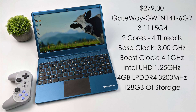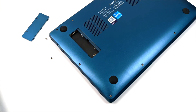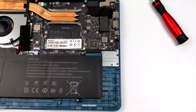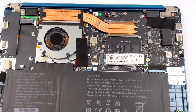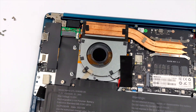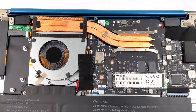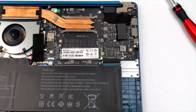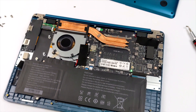It comes with Windows 10 in S mode but you can easily upgrade from the Microsoft Store, so we're running Windows 10 Home here. This does have AC Wi-Fi and Bluetooth 5.0 — the last Gateway laptop I reviewed only had 2.4 gigahertz Wi-Fi built in and it was pretty slow. Upgrading the storage is really simple with just two screws, and the RAM is confirmed not replaceable. It does have a pretty massive heatsink for this little i3 CPU, and through all my testing it stayed super cool even with the CPU running at up to 30 watts.